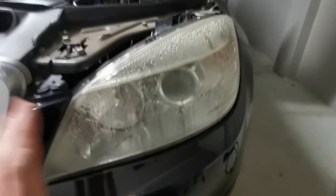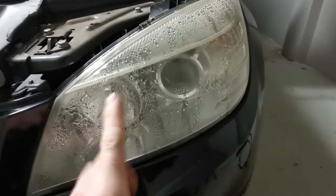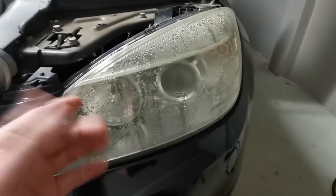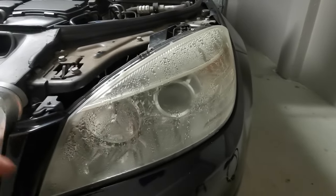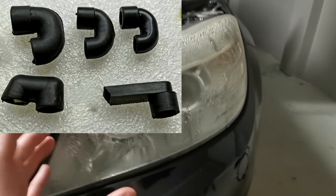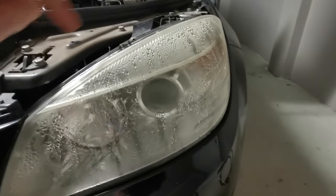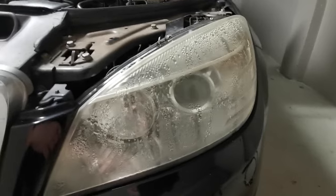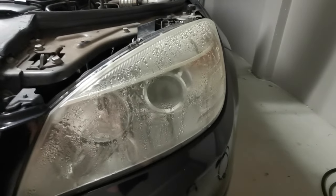If you've found moisture build-up from a temperature change — maybe going from a hot summer into winter — it can be a case of the backside of the headlight. You have seals across all of the different caps that the bulbs go into, and maybe you have some issues there, or with the vents. Headlights have different vents that allow them to breathe and you can get blockages in those. As you can see on screen, they can be located in areas that are difficult to get at, meaning you might have to remove the headlight. In some cases they're up around the top side and you can pull off those rubber attachments, blow them out, and make sure the headlight is able to breathe.